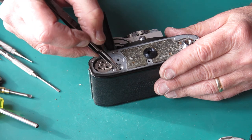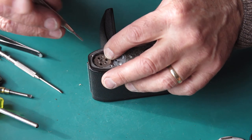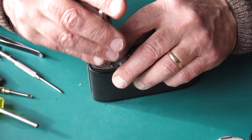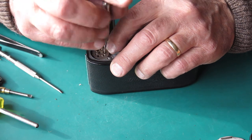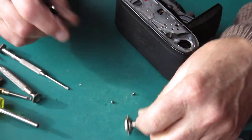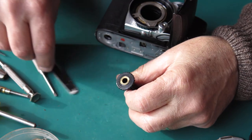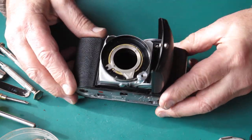Here's the back catch rewind button catch. Three screws hold it in place. This is the guide bush for the film advance shaft — those screws are loose. I'll remove the take-up spool; I want that bush out for the ultrasonic cleaner. Now we're getting to the parts that don't work — the focus is stiff and very reluctant to move.